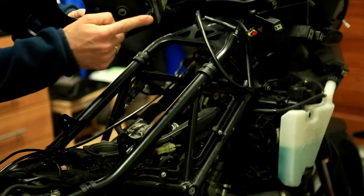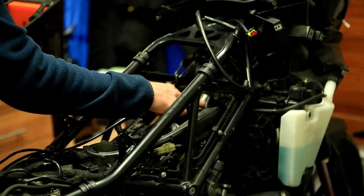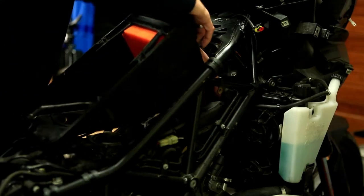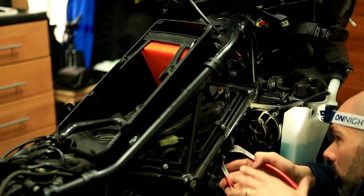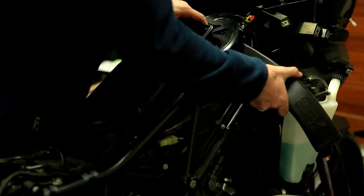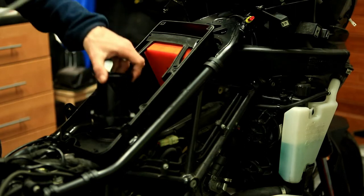Once you've done that, reinstall your lower air box. At the bottom there are two prongs and they need to slide into the rubber housing on the SLS valve — you can see the two notches there, so that needs to slide into it. There's one little air intake at the bottom and one down here. Then slide this air intake plastic piece on both sides and put back the trumpets.